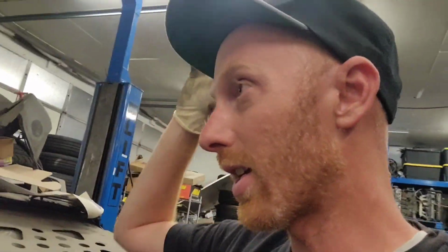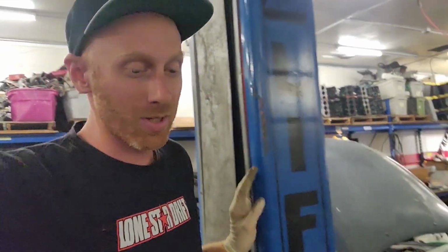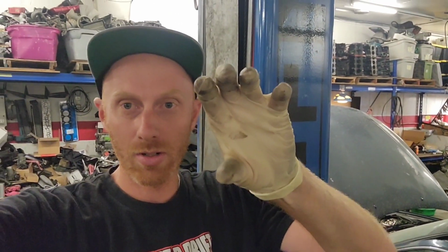What I've been doing is modifying the wiring harness, which I did, and I did it all backwards and upside down, and I went to go test it and nothing was working. I must've been really tired, because when you pin the connector, number one would be in the top corner, but I had it upside down because I wasn't paying attention. Even though I've done this 100 times, I still made a mistake.